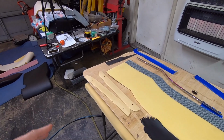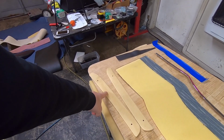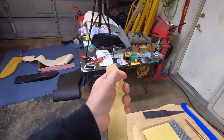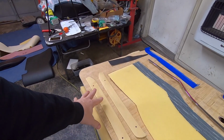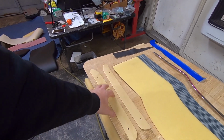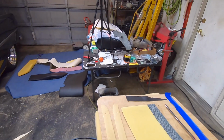I have decided I'm going to sand these down clean. I'm going to wipe these in filler, just a thin coat, go back and block them out because they are pitted. I had blasted these and primed them, but they are pitted. So I'm going to go back and block these out, and then when I prime my hood Sunday, I'm going to prime these pretty heavy and then sand them, and then I'm going to paint them. So these are just going to be painted trim pieces and put on the seat.